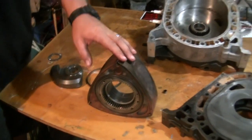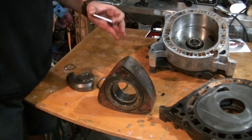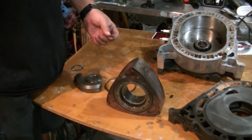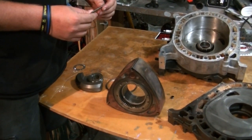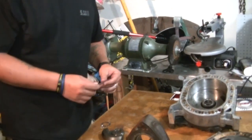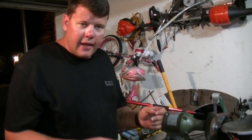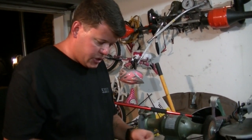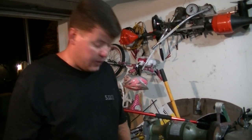So, going into the apex seals and the longevity of apex seals, Mazda originally called for the simple fact that you could change your oil every 3,000 miles by adding a quart every 1,500 miles. What us rotary nuts got into is we started finding that apex seals were only good for approximately 100,000 miles on a well-taken care of, well-oiled engine. At the 100,000 mile mark, things started to become a little sketchy. It was a situation of, you know, can I take this across country or am I going to have to rebuild it in the next 15 miles?